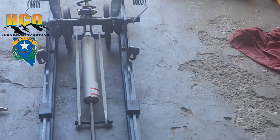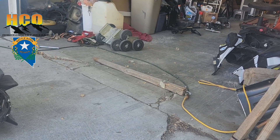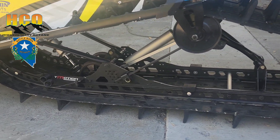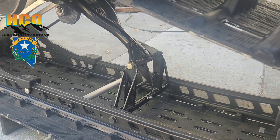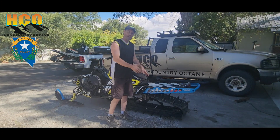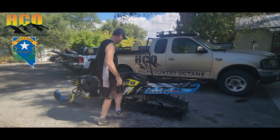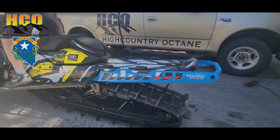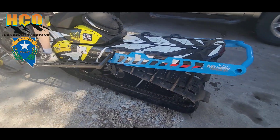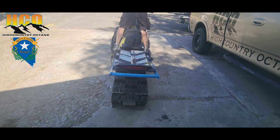Videos will be coming this winter on how it all works out. Once I get everything up under the sled we'll see right away how she looks. Now that I've got her back in, the install wasn't too bad and the geometry looks like it will work okay. Now we're going to watch as I transfer my body weight on the chassis and see how it affects the track. In the old days the track would sit on the ground and the chassis would roll with the T-motion. Now you can see the track is lifting a little bit on the edges.